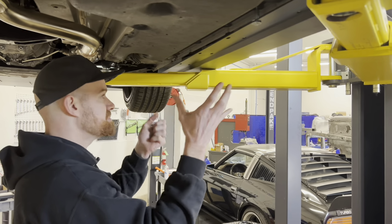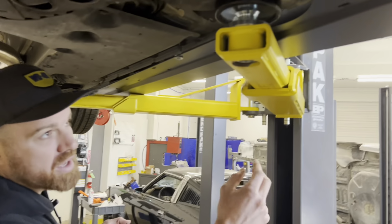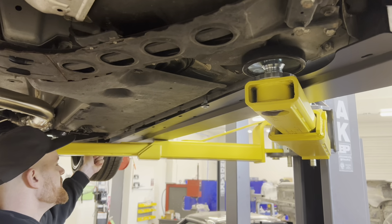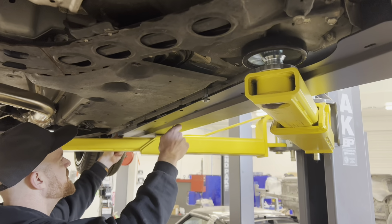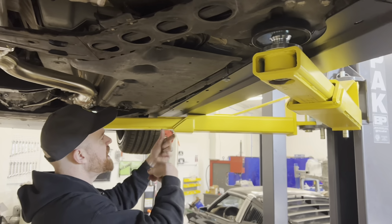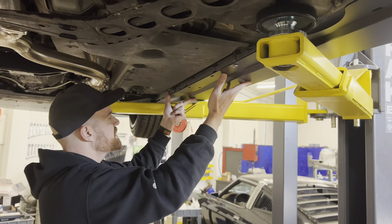And once I've got that in position and made sure that it's aligned, that's when I'm going to go ahead and drill this hole and then mark this hole. You could drill it, but you're going to have to ultimately pull these screws back out, or at least this front one, to shift it so that way you can get the riv nut tool in, pop that in. So now that that's in there, you'll slide that back.